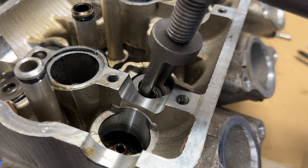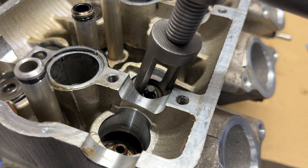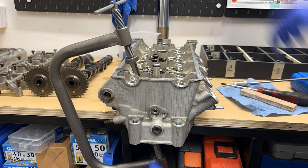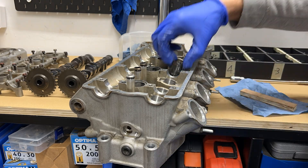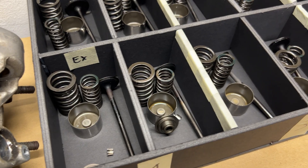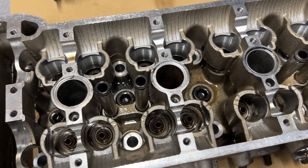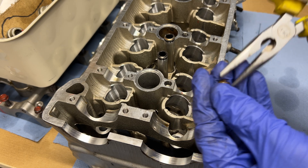I got to work on the rest of the valves. With the last bits removed, I marvelled at my organisational prowess and didn't see anything worrying amongst the parts. Looking over the head, there were still a few bits left to remove. I started with the valve stem seals, as I've been replacing these on reassembly. My needle nose pliers and a steady hand made short work of these.